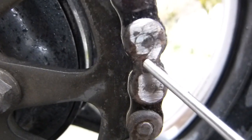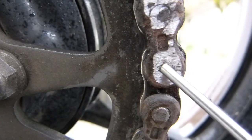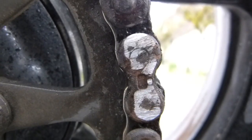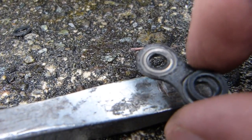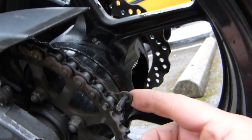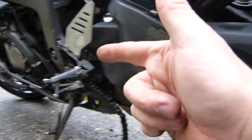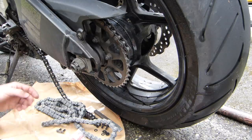After a few taps, you can see the circular outline of the rivet. Start roughly where it should be, and it will shape up in a few taps. I've removed the first plate using the cold chisel, and then this link just slides out. Now you can see how we're going to use this used link and its pin to pull in the new chain onto the old sprockets. The removed link is the throwaway part.